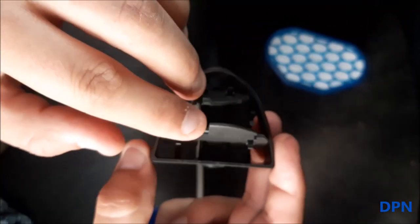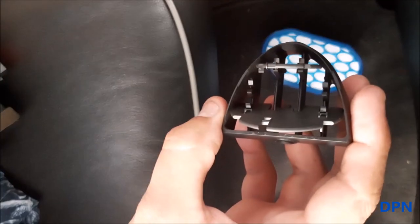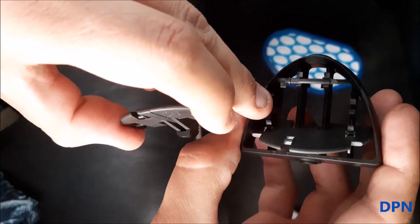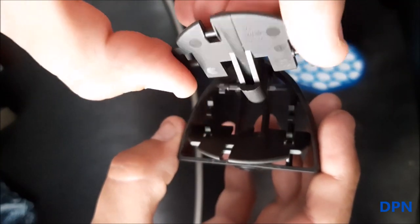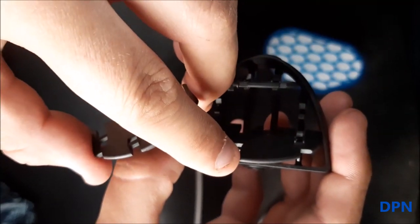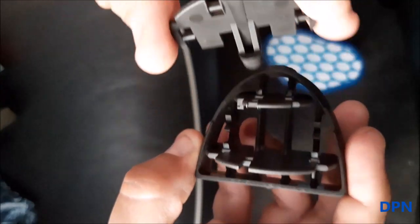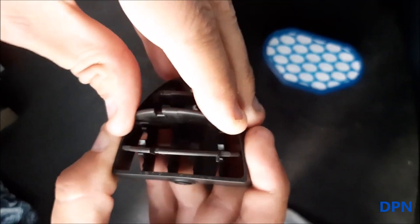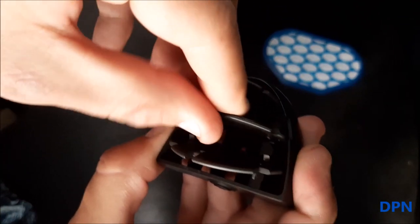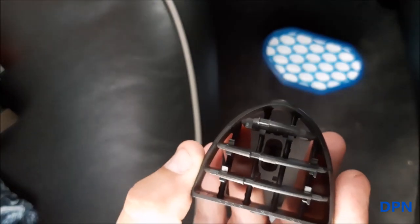The inner grille is out and that gives much better access to reassemble the fins — hopefully no actual repair needed, just reassembly. We get the plastic fin piece back in. You can see there are two little clips, and corresponding slots inside the housing. You also need to make sure the slot on the fin lines up with the slot on the linking bar that controls direction for all of them. Carefully slot it in and clip it into those two positions.